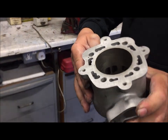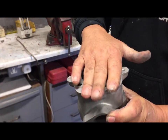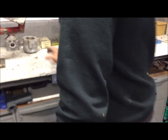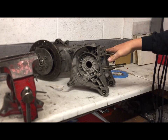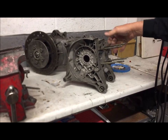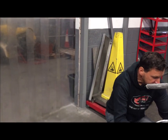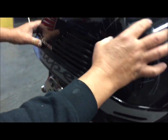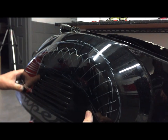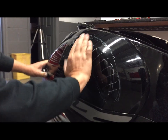36 horsepower. It's going to use a billet central head and spool cap with that conversion. This is the engine. We're shortly going to bolt a cylinder onto here so we can get the routing for the exhaust system out. This is going to take the place of this old four-stroke one. We'll come around here, Steve, and show you where. This is roughly where the exhaust layout is going to be, as you can see. This will be cut out, and then we'll place a slightly bulged mesh in here.